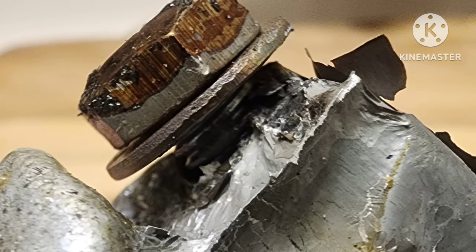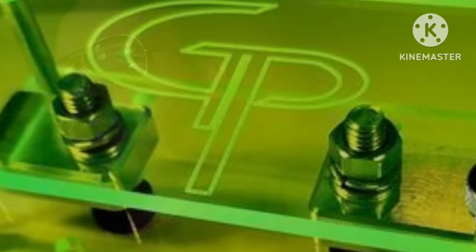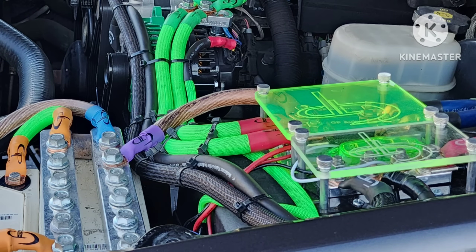You can also use a crush washer — the split kind. A split crush washer is a high-torque washer that needs to be torqued down quite a bit to work. The ones with little jagged edges and burrs are better for a low-torque application. If your fuse holder will allow for a split crush washer with a lot of torque, that works — just make sure the crush washer is above the fuse and below the bolt head, on top.